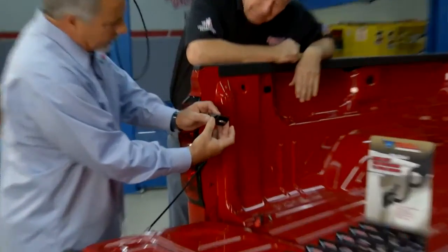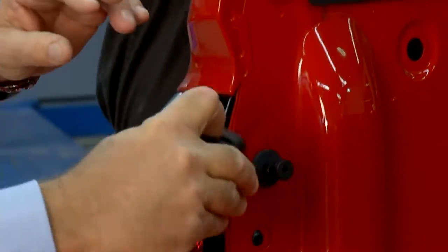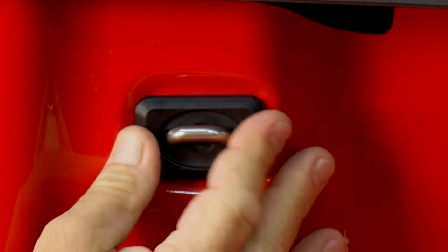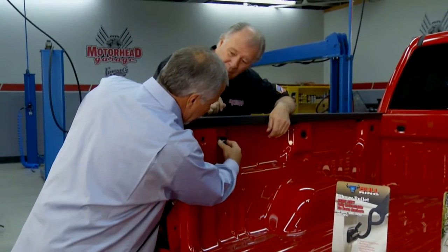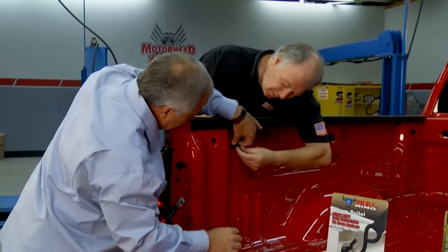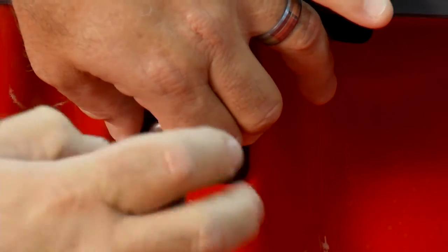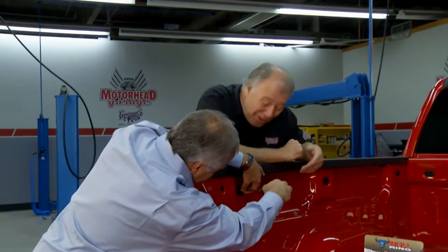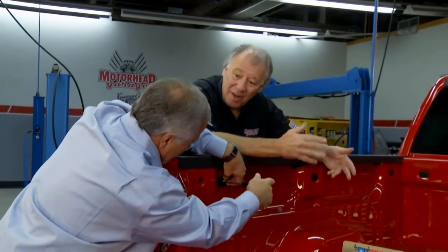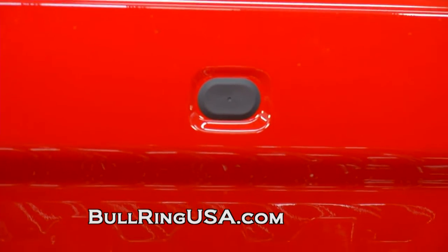The Chevy Bullring unit consists of a nylon base, a steel metal bracket that goes behind the sheet metal, and a cover. Run the nylon base into the hole first, get it up and in, then lift up the bottom metal plate and it drops in — product is installed. Move it around until the recess locks into the hole. Add one screw, and it's done. It's a pretty simple install. Once you get all nine in, you can tie down just about anything you need in there. This is the first truck that has the availability of tie-downs on the front bulkhead.